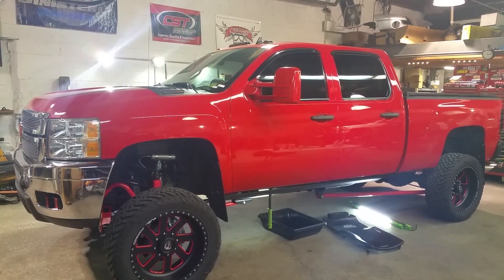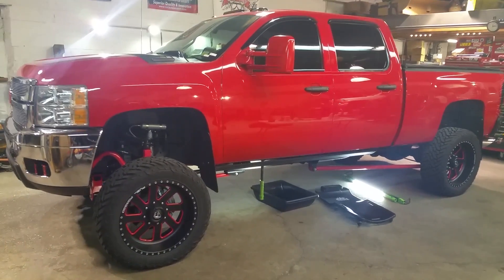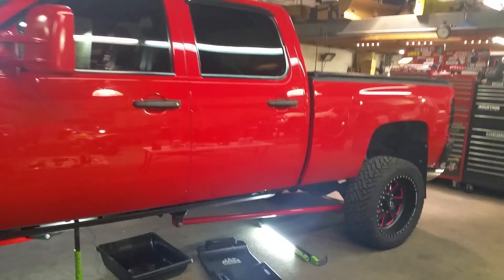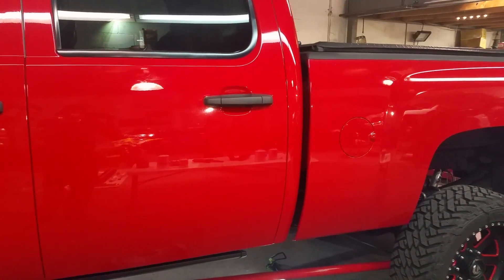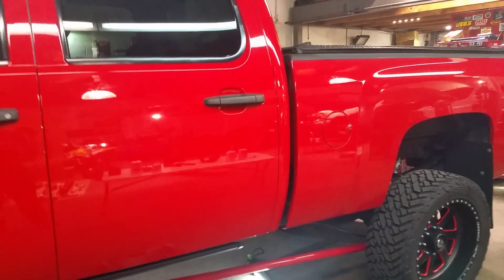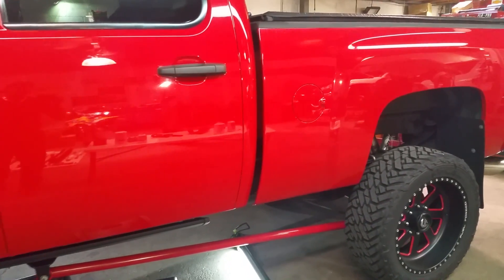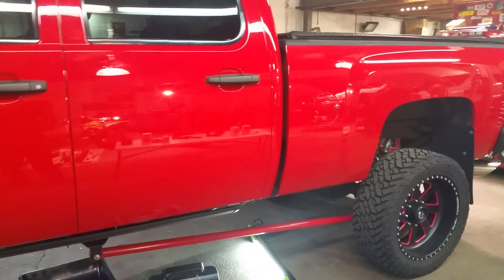The vehicle we're going to use here today as the example is a 2011 Chevy Silverado 3500HD. It is equipped with the LML Duramax, which does not come with any kind of lift pump from the factory. Whereas Cummins and Ford do come with a lift pump either in the tank or on the frame rail, both serving to provide fuel transfer up to the high pressure injection pump. Duramax chose not to do that — they drag everything from the tank up to the pump under vacuum suction. So this is where we choose to mount them on the LML chassis designs.